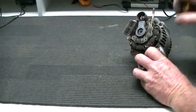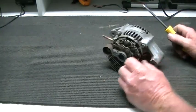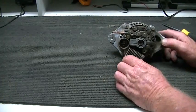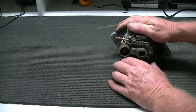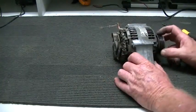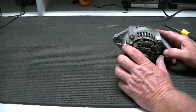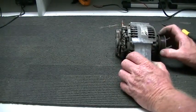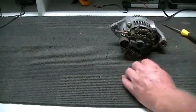We're going to have to drill these open hollow rivets out and then cut the wires underneath — I can't be bothered desoldering them. A little about this alternator: it is a 60 amp alternator, only a smaller one, but that means we can put in 60 amps. At 12 volts that's 720 watts, and at 24 volts we get double our wattage — around 1,440 watts.